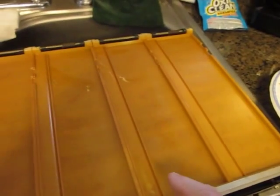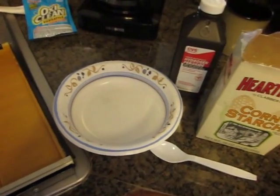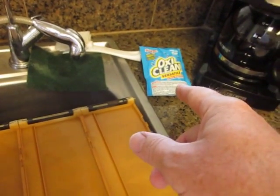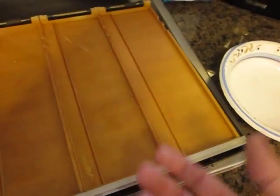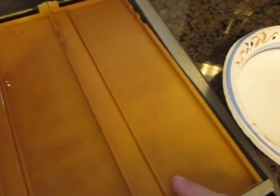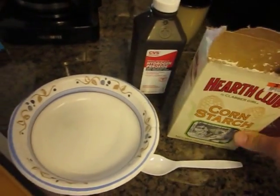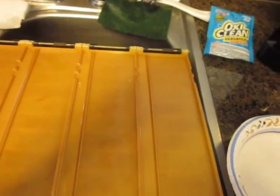When I researched how to de-yellow plastic on the internet, I came across a good article that said the way to do it is using a mixture of hydrogen peroxide and OxiClean and sunlight — having it out in the sun, the UV rays activate it and somehow change it back. The way you keep the hydrogen peroxide on the plastic is to mix it with a binder. I'm using cornstarch and hydrogen peroxide to mix into a paste, and then once that's on, I'll put some OxiClean on it as a liquid on top to activate it.